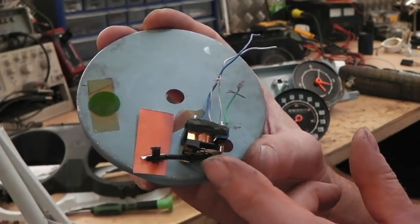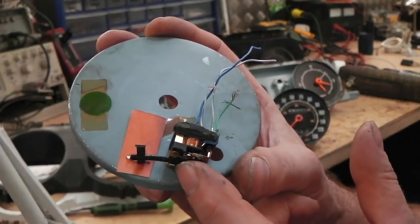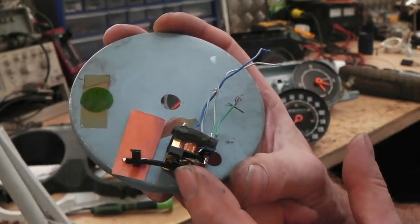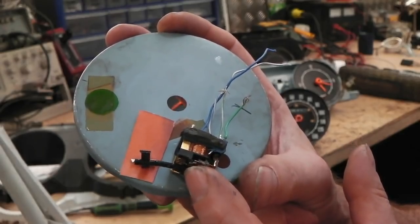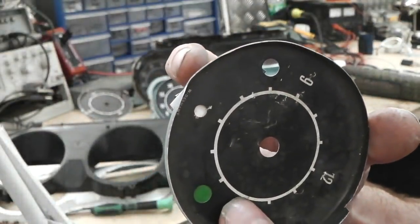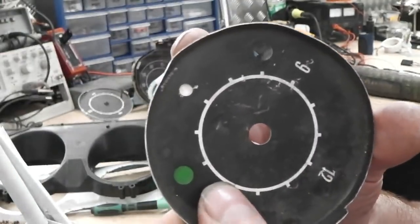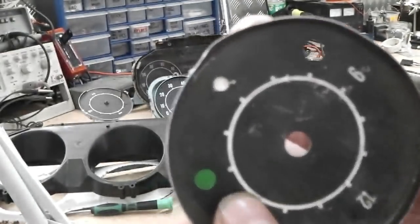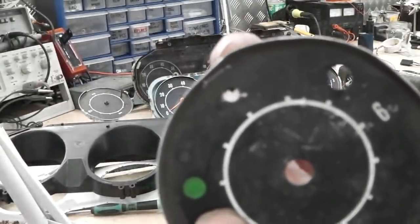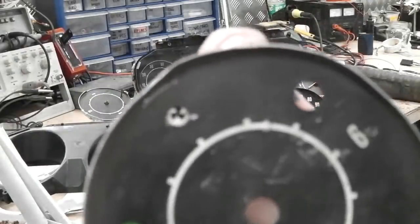And this little relay that I've adapted there, I've just glued on some cut-up zip tie, would you believe, and a piece of card. You can see when the relay activates, the arm pulls in and moves that piece of card. On that card is a picture of a little miniature fan taken from a logo off the heater blower control fascia, copied from that, and a sticker made by Mark. When the relay pulls in, you'll see a little logo of a fan pop up into view. Let's just activate the relay. There we go. Can you see that popping into view?